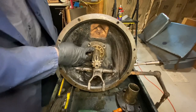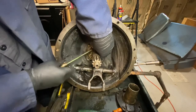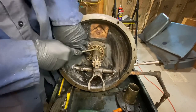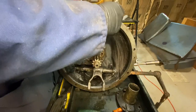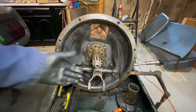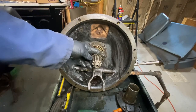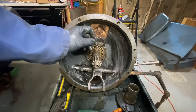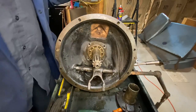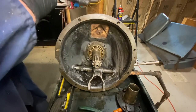Next we're going to take these snap rings out. I use two pliers — I'll show you on the next one — you pry one side up and run it around, try not to let it spin, run it around till the clip comes off. These are the hardest part about a 39 transmission — taking the bigger one off right here on the edge, there are multiple ones on the inside. When you get a rebuild kit, don't reuse these; the way I get them off actually bends them. I keep a little box of used ones just in case I need one in a pinch.